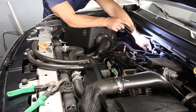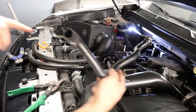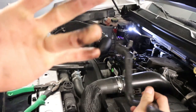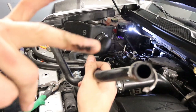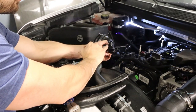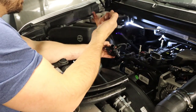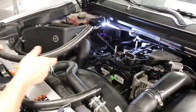I feel like I'm getting somewhere. Now if we look here, there's definitely plenty of oil in that thing. Let's try a clean finger — oh yeah, this is exactly why you need a catch can. All that crap is going right back into your intake. See my clean finger here — put it in this valve. Now this is all the crap that's coming out of your engine going back into your intake. See all that crap? Let's go and sort your intake. Let's do some routing.